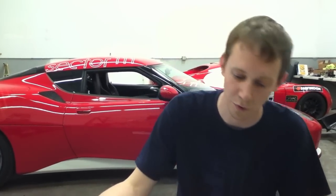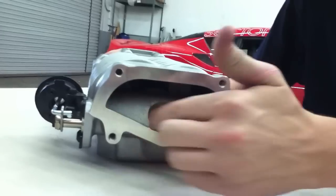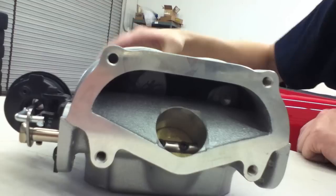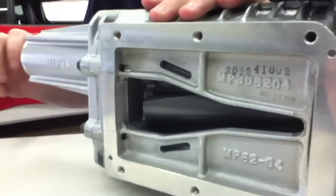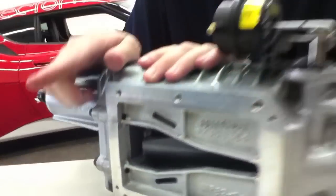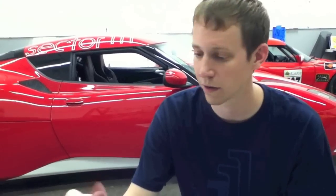Here in front of me is the MP62 supercharger. Air is drawn in to the supercharger through this primary opening and enters into the set of two rotor blades — you can see them spinning inside of there. The rotor blades actually attempt to capture a fixed amount of air per blade set per revolution, and then force it into the engine's intake manifold. This system pushes more air into the manifold than what the engine would naturally consume during naturally aspirated operation, which builds pressure. As that pressure builds in the intake manifold, there's also heat that's built inside, and these two pieces are keys to the limits of the supercharger.